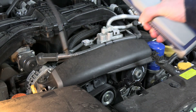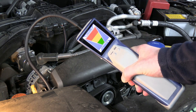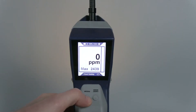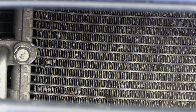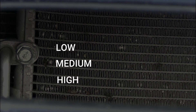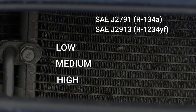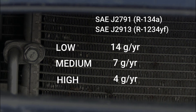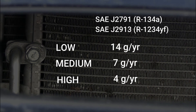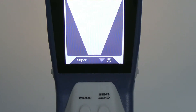Now you can continue looking for a higher concentration of refrigerant to pinpoint the leak location. To reset the zero point, move the probe to clean air for a few seconds and then check again to verify the leak. While in pinpoint mode, the AST300 ppm has four sensitivity levels: low, medium, and high — which can be used to find leaks according to SAE J2791 and J2913 guidelines — and super sensitivity, which can be used to find even the smallest leaks. Press the sense zero button to toggle between sensitivity settings; the current sensitivity is indicated on the bottom of the screen.